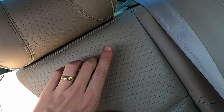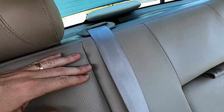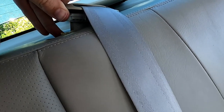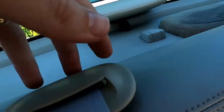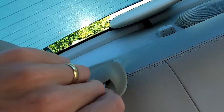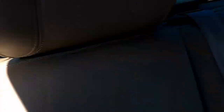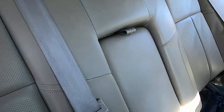An extra step I wasn't aware of: as I started to lift the seat back out, the top seemed like it was still held in place — it was flexing the seat a little bit. The seat belt guides actually clip into tabs on the parcel shelf, which was holding the seat in place. You have to pop these out. For the back I got my fingers under and lifted up, then under the front I pulled the belt out of the way and used a flat blade screwdriver to push forward, which released each of the tabs. I just need to release this one and the one over there and this should be freed up enough to lift.